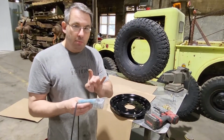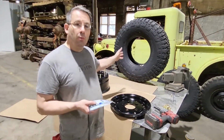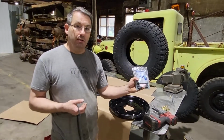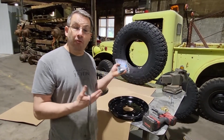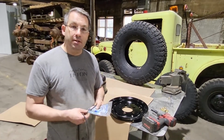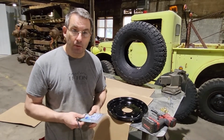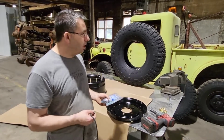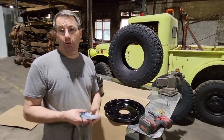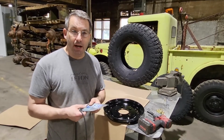And it's also made with a special static charge so that as you're driving down the road and you come to a stop, these will hold their position for up to several minutes before falling out of place. Normally with an active balancer, the active balancing doesn't kick in until about 35 miles an hour. Because of the static charge though on these, they will hold, so after you've got that initial driving done, they're actually still working even when stopped.